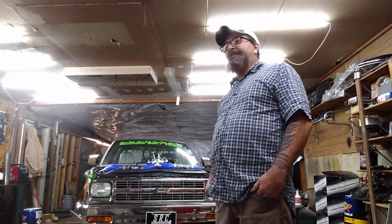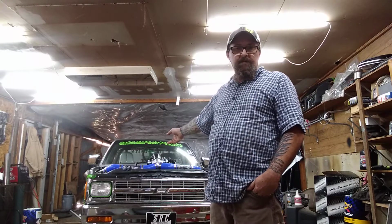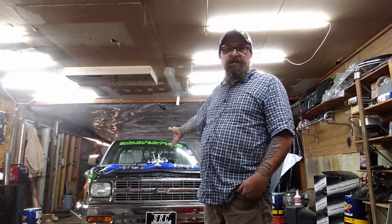But they say 15 pounds. If 15 pounds doubles the horsepower of an NA motor, then this thing is making in excess of 1,500 horsepower the way it sits. Right around the 1,500 mark, because I know what it makes NA. So 15 pounds, if that doubles it, it should be just a bit over 1,500 at the flywheel. Say at the worst you lose 200 through the drivetrain, which you wouldn't. You'd be 1,300 at the back tire.